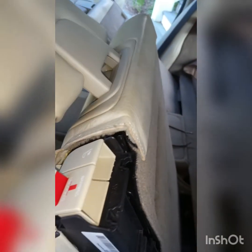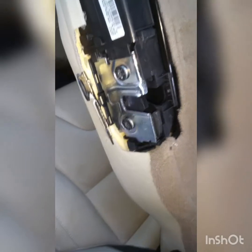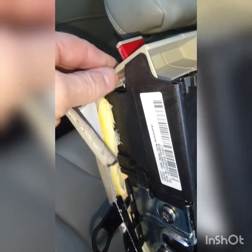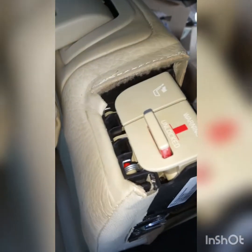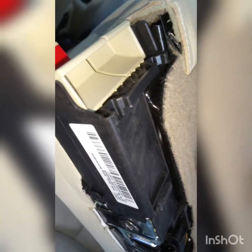That little piece didn't come with the pieces I ordered — it might be prudent to try to order that separate little piece. I've got the T40 bolts back in. Notice the three little tabs that fit in here, and then there's some various little plastic pieces that help put the seat cover back in position. There it is reinstalled — the leather is tucked back into position and held in place. Now we just have to put the plastic cover back on.